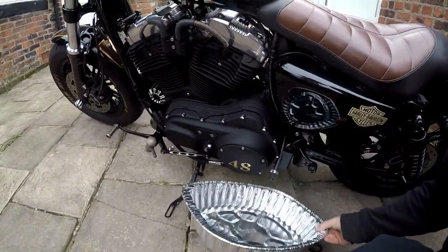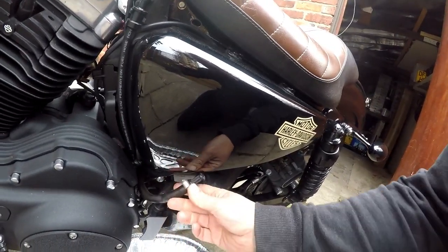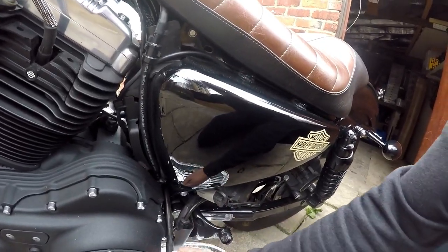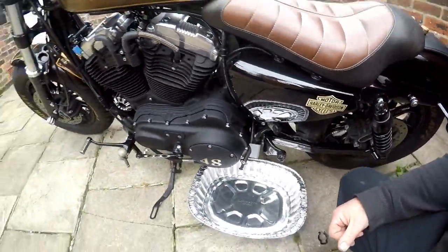If you can't unscrew your oil filter by hand, use an oil filter strap. I have an aluminium cover on mine, so we'll see that in a bit. Always carry a few rags for spillages, and if you're struggling for something to drain your oil into, go into the kitchen and pinch your baking tray — absolutely perfect. So here's your drain bung, which is just tucked up out of the way, secured with a clip. Take the clip off, bring it down into position, and you can see the tray is going to catch that oil without any spillages.